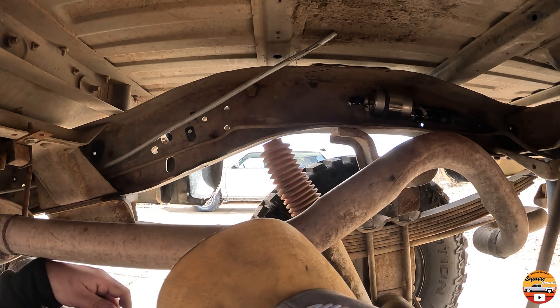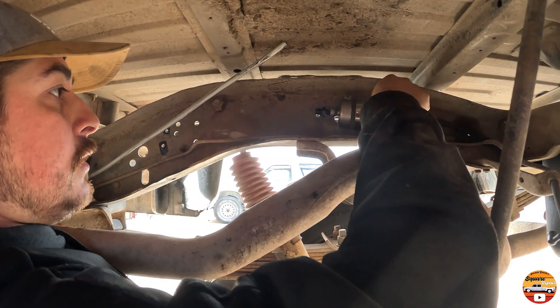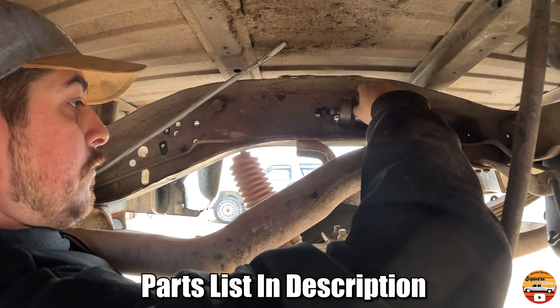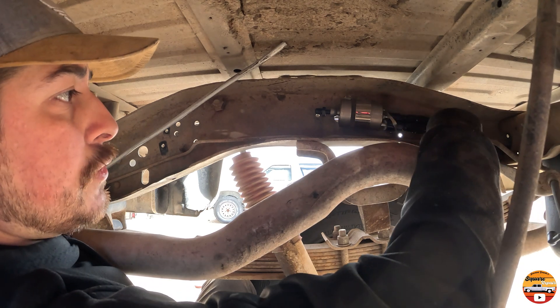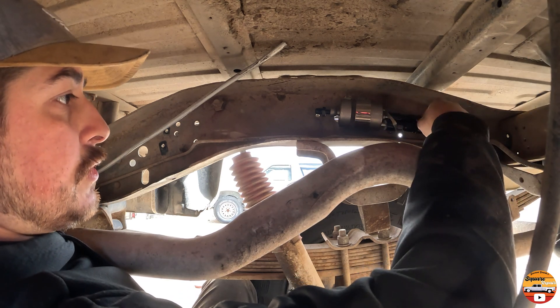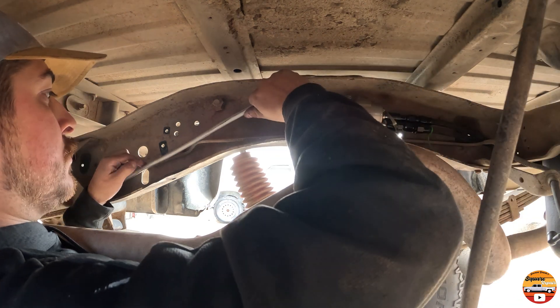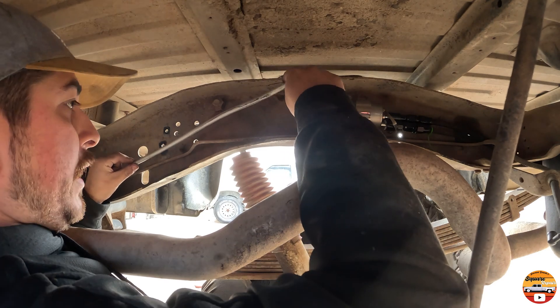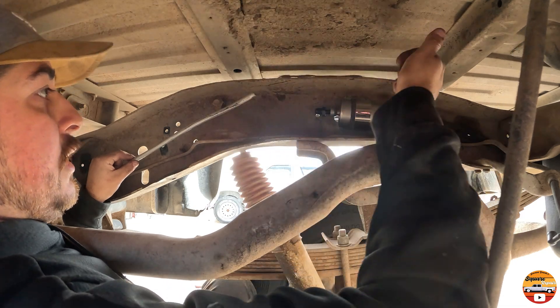The first task - we have our fuel system. This is our fuel filter and fuel pressure regulator. This is commonly known as the Corvette style regulator, and we have our inlets coming from our fuel tank. This one is our inlet, the middle one is the return. You can also see here we have this 3/8-inch aluminum tubing. 3/8-inch is the same size as AN6. We went with aluminum because it doesn't rust and it's very easy to manipulate with your hands - you can just bend it where you need it to go.